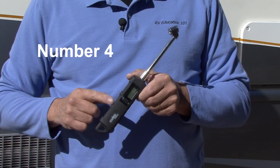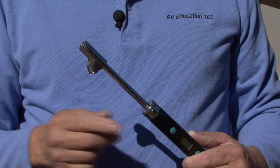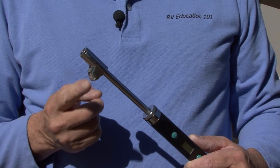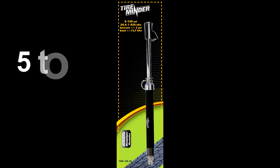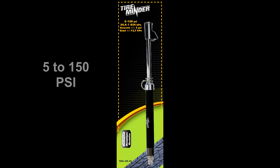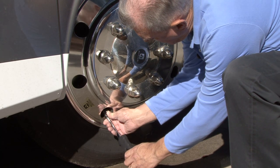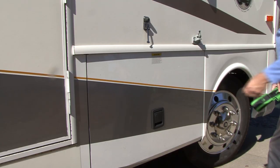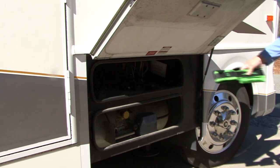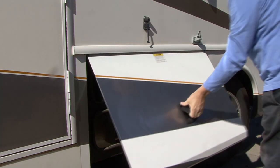Number four is a quality tire pressure gauge. I recommend you spend a few more dollars and get a good tire pressure gauge. If the gauge will be used for checking dual wheels on a motorhome, the chuck end of the gauge should have a dual-foot design to make the job easier. Always select a gauge rated higher than the inflation pressure of the tires you are checking, as applying more pressure than the gauge is rated for can damage the gauge and affect accuracy. Try not to drop or hit the gauge, and store it in a protective covering or case.